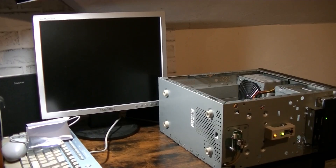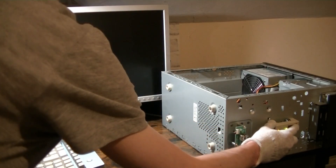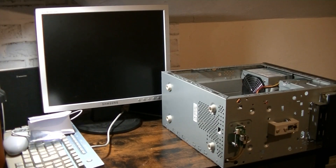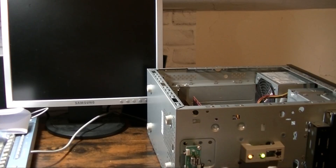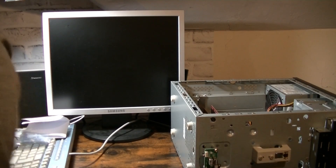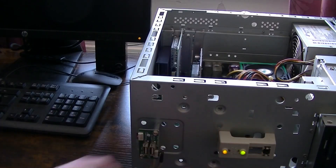However, nothing else happened for a few seconds — until the PC speakers started beeping constantly, with no signal output on the monitor. I immediately powered the computer off in case this was a potential overheating issue; maybe I hadn't applied the heatsink properly somehow. I tried powering it on again, but the same thing happened: no signal, followed by a constant beep 10–15 seconds later. Even leaving the computer on for a few minutes made no difference. I also tried reattaching the CPU fan connector and removing the BIOS battery, but the same problem persisted.